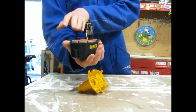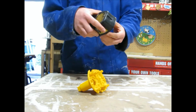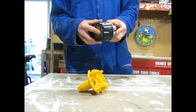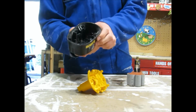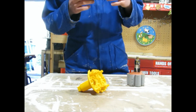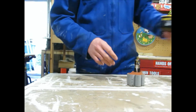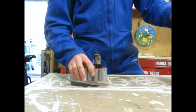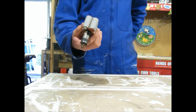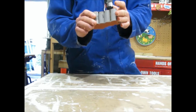Now obviously, because it's such a tight fit, you are going to have to solder the batteries, your new battery pack, into exactly the same shape. So there's the shell. This is PC and ABS plastic. Put your shell aside. Also, not all batteries are the same. I know the Makitas have 2 batteries in the shaft. So you definitely want to take pictures of this, just because you have to get it exactly the same.